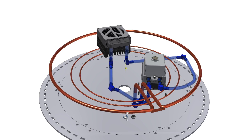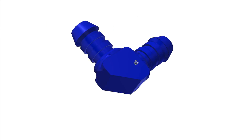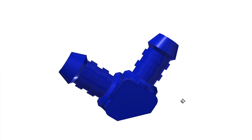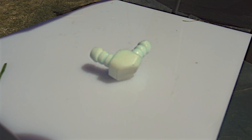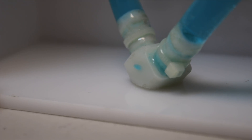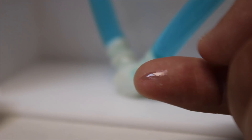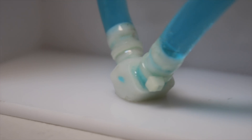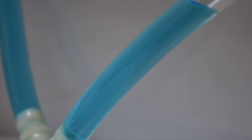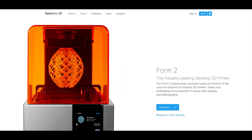The next hurdle to overcome was the plumbing and the routing of the coolant pipework. In the spirit of DIY build I ordered silicone hoses and wanted to 3D print the hose fittings, but this became a bottomless pit of design and redesign. The hoses fitted very well but they failed due to issues where the parts were sweating coolant, as the layer adhesion was not the same as a fully moulded part. On the other hand, if these parts were manufactured via an SLA printer then this would have never been an issue.